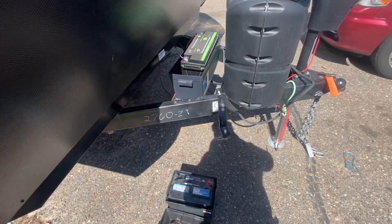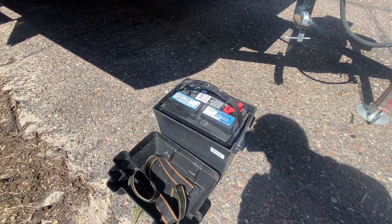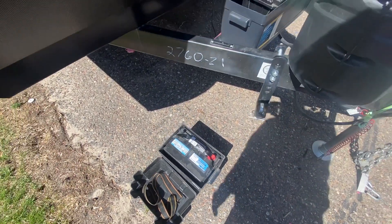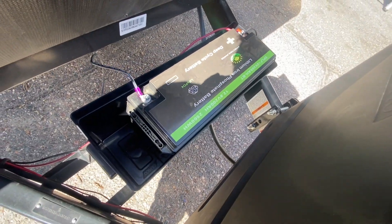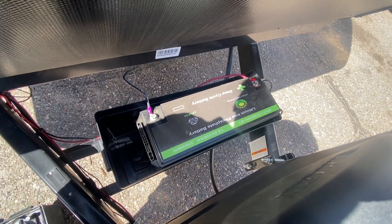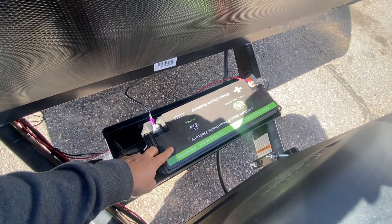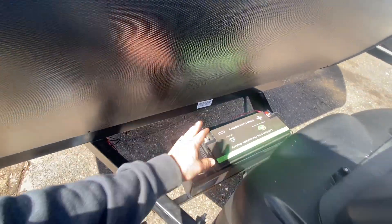This may be a familiar scene to many of you. You start out with a little battery like this from the RV dealer — nothing special, just a marine deep cycle battery. Switch out the box for a double battery box and put one of these slim case batteries in it. This is a lithium battery with a built-in JBD BMS, so we can monitor this from our phone. You don't need an external shunt, nothing. Drop the battery in, it goes. Works great.